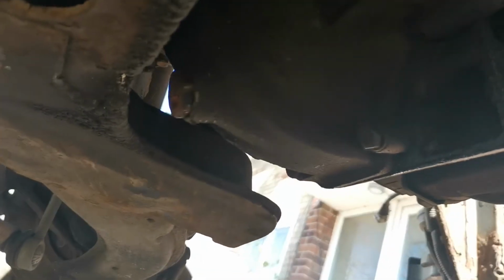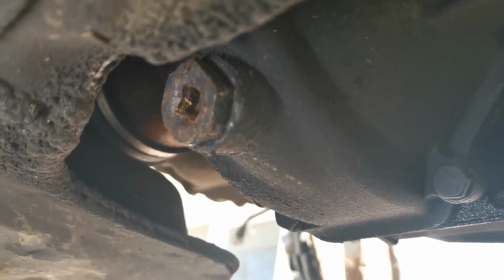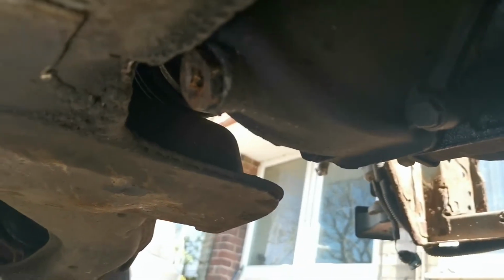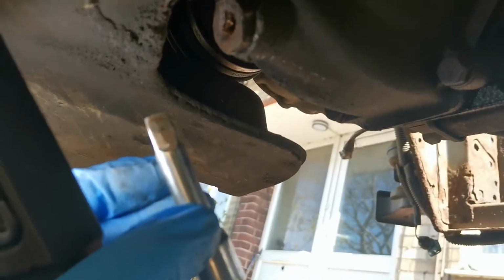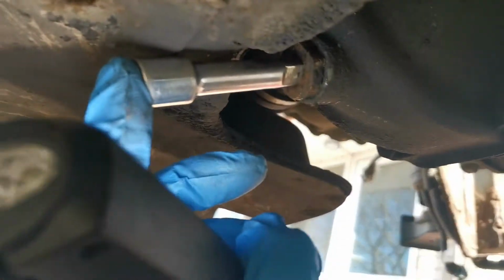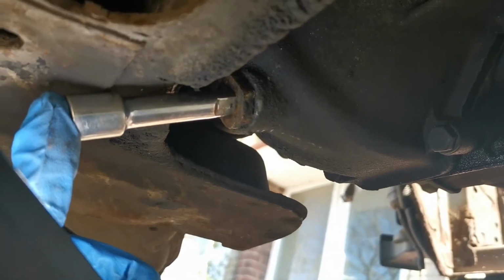I have also, off camera, because there is just a little square in there, don't know if you can see it, but Renaults, Peugeots, Citroens, they all have a similar thing, and you can buy a special tool to undo them. I have had to be ingenious and make my own tool in the past, so I thought I'd try that homemade tool, which originally was a 3/8 small extension, filed down. What I'd normally do is put that in there, tap it into place with a hammer, and it would sit much more snugly than the pre-made manufactured tools would, and it would normally undo them every time.